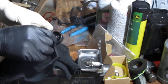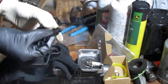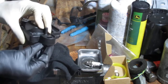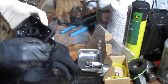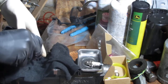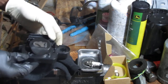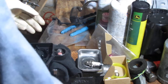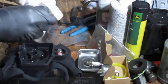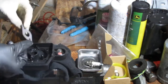We've got a new primer bulb. The orientation — I'm putting it back the same way. It just has these tabs — you squeeze them together and slide it in here. It should just kind of push down and clip in. Now it's clipped in. Then we have a gasket for right here. This is the old gasket — it has two holes. The new one — I already saw the part number for that.